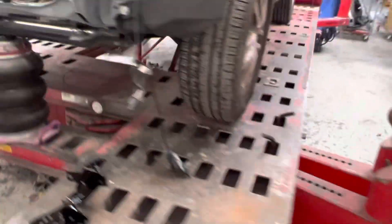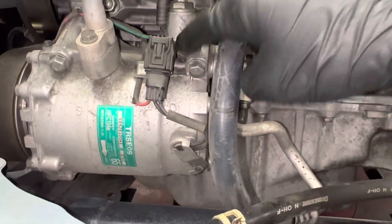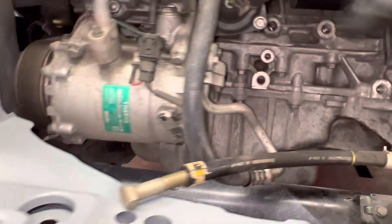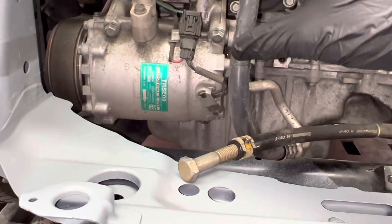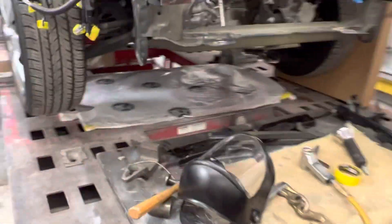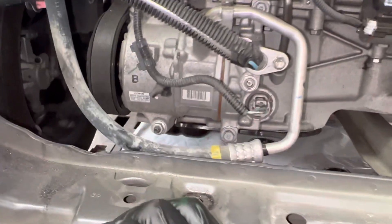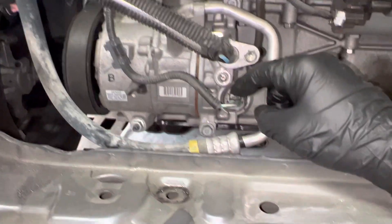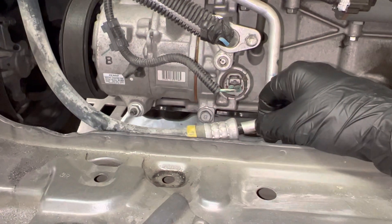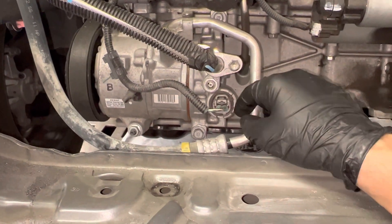Now here we come over to a mechanical pump. This is a mechanical pump — you see that big old thing up there. This is a mechanical adjustable compressor. All the way back in 1985, General Motors Cadillac had the V5 — that was the first mechanical operated variable displacement compressor. Nowadays we went over to electric, and unfortunately they fail a lot.